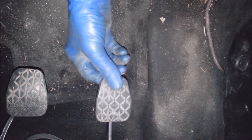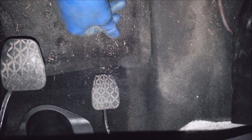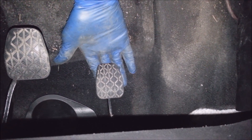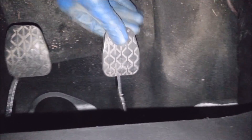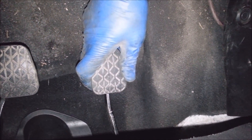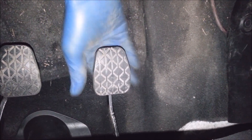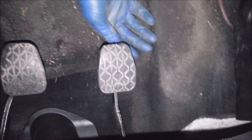There's no place for the fluid to flow except up. Now this isn't necessarily going to push the air up by itself, so what you got to do is push down on it really hard and it's going to force fluid flow to go past my vice grip. After it's down, it'll stay down because there's no pressure to pull it back up, so I pull it up by hand. You don't want to hit this more than once because some master cylinders don't have a retainer clip for the piston, and if you keep pumping it you'll get one where the piston completely pops out and then you got to take everything apart.